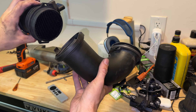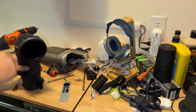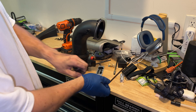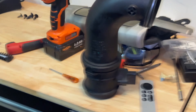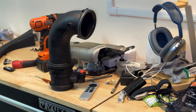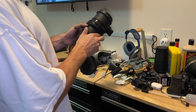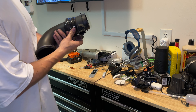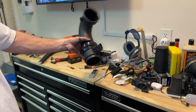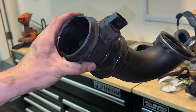Fixing the air intake hose: you might have difficulty reconnecting the air intake hose — you'll have an easier time applying some lubricant. WD-40 is not the best choice but will work in a pinch to lubricate the gasket enough to get the hose back on. Note that silicone lubricant can contaminate things. Regardless of your choice, apply a small amount on the gasket and it will let you slip the hose on much easier. To seal the hose, I used self-fusing silicone tape because the tape was $10 and the hose was simply missing a clip, while a new hose is $70. As long as the tape is stretched tightly, it activates and bonds to itself.